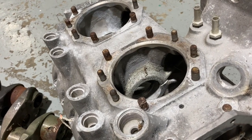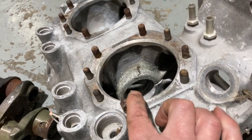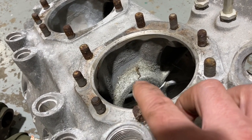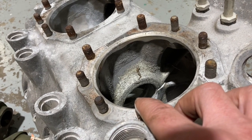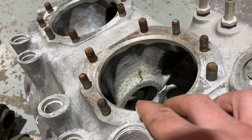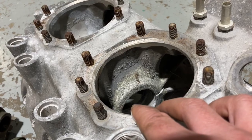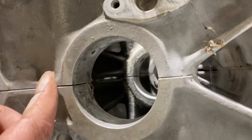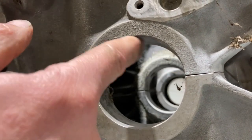What the operator noticed on this aircraft was that just for a couple of flights in cruise, the oil pressure dipped down below where it normally would be — not particularly low, just a little glitch — and then it appeared to return to normal for a flight or two. They casually brought it to us on Monday morning asking if anything was wrong. When we pulled the filter, you've never seen so much metal in your life. The engine overhaulers say that when the main bearing starts to shift or tear itself up, the oil pressure will go down a little because you have clearances you didn't have before.